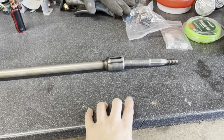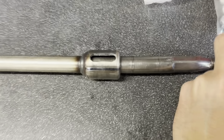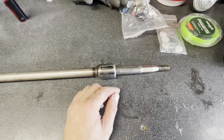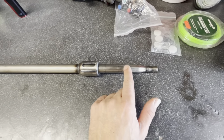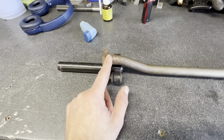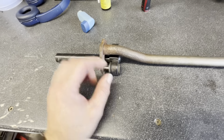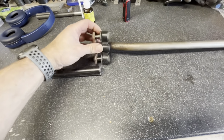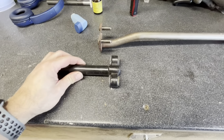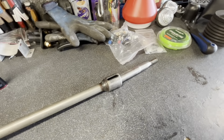A steering column on a Mark II Fezzy - you've got this section here which goes into whatever this thing is, I think it's probably for steering lock actually. Let me zoom out. Here sits like a spring and a bush. Down here you've got this little fork, this little swan neck, and would you believe this just pushes into the bottom of there. That just pushes off - pushed it on as if by magic. So that comes off the steering rack and this just hooks in and is held in by the spring at that end.